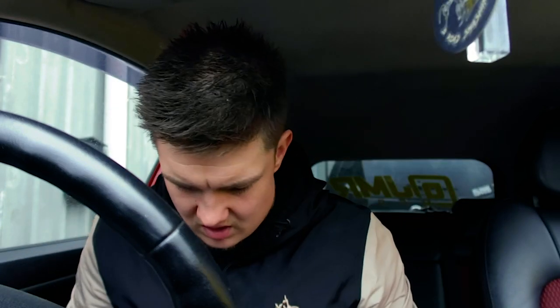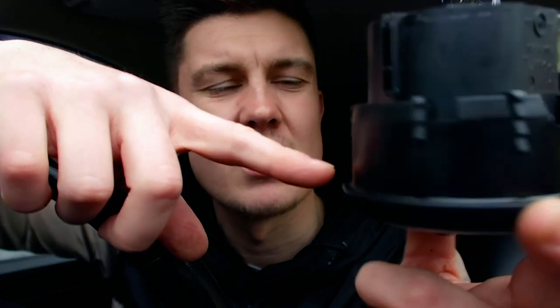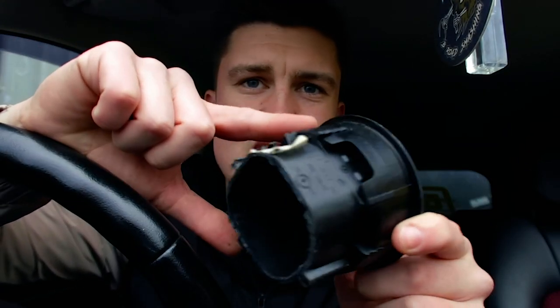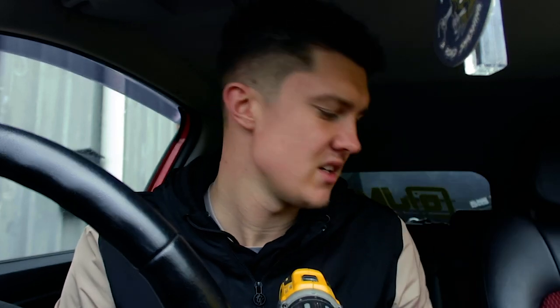So I've just basically cut it in half. That's the flap that was left on the inside, that bit's been cut off, and we still have a way of shutting it closed on the outside. Test fit time - let's see what happens. We're close, we're close. I think that's to do with the ledge depth here, so what I'm going to do instead of taking it off the outside is bore the inside with a drill and a sanding wheel, and then see if we can keep a bit of the ledge on the inside for it to stop at.